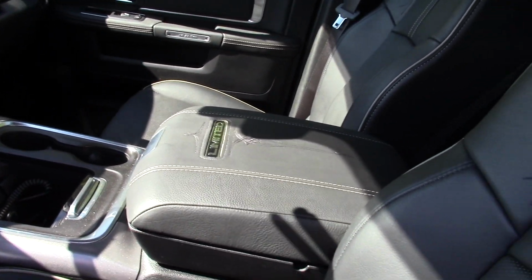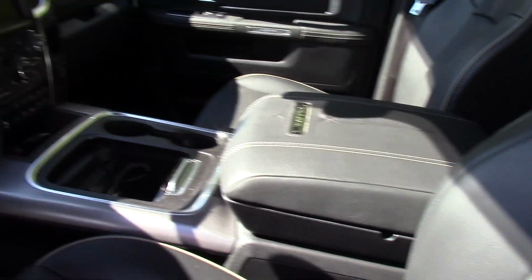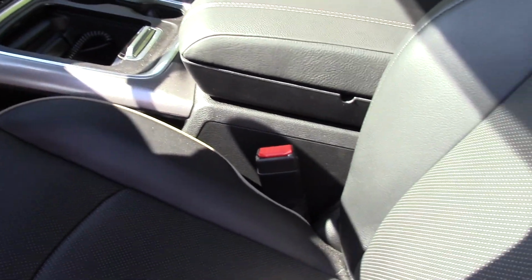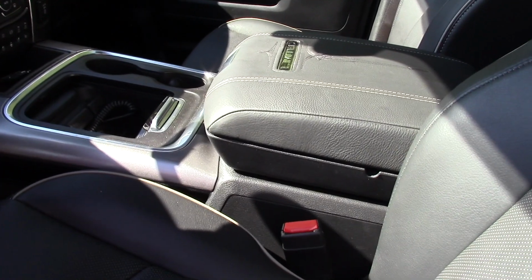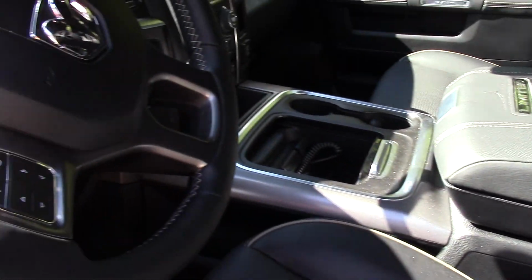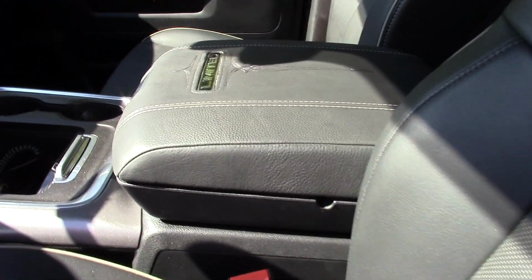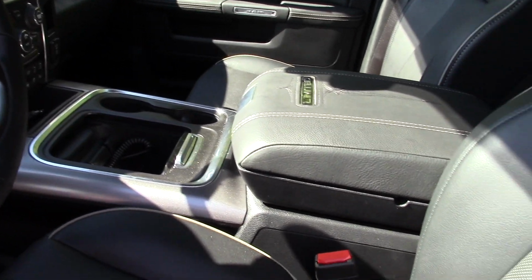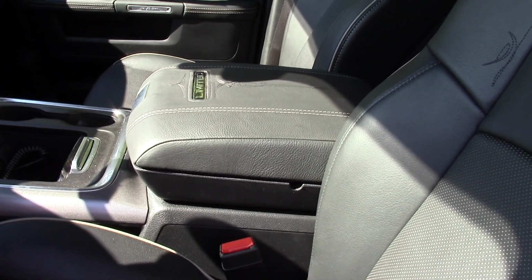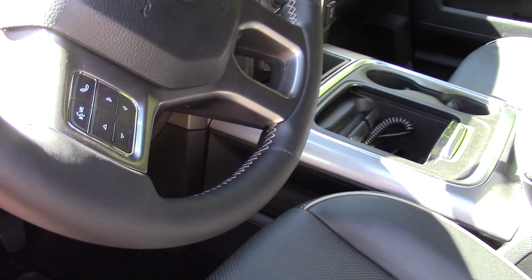This truck, I run between 5 and 7 with this trailer, and that's the biggest difference that I've noticed of switching from 3500, 2500 single rear wheel to dual rear wheel: braking. You do not notice that trailer is behind this truck as far as braking goes. A lot more confident feel to it. It stops when you want it to, and you really don't notice that you're applying that much more brake pressure. It just kind of works the way that it does when it's unloaded.